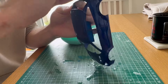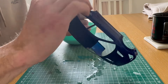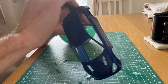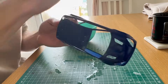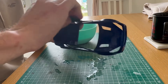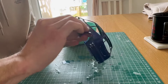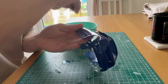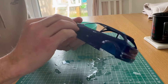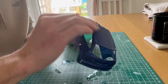Sadly that means I am now in the process of destroying that lovely paint work by flattening it down with some thousand grit sandpaper and then following it on with some three thousand Trizac, ready to be re-primed and repainted. I hate doing this with a lovely paint job, but it's definitely not going to look right if it's got bright highlights where there should be shadows. So what I've done is I've flattened it, as you can see here, and made it as smooth as possible to get the car basically back to a nice standard ready for painting again.